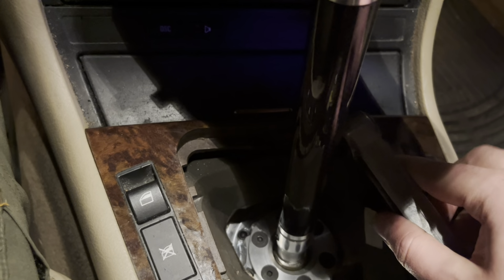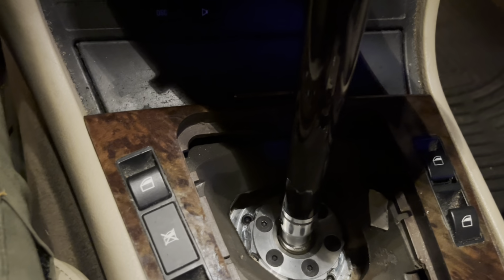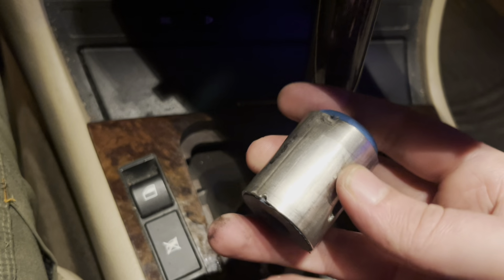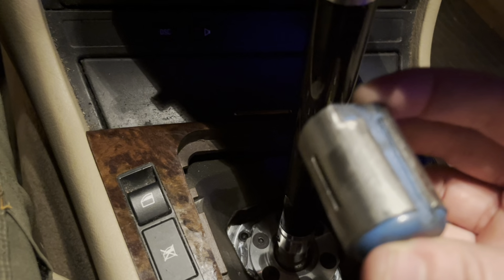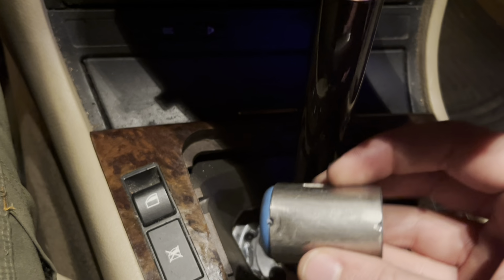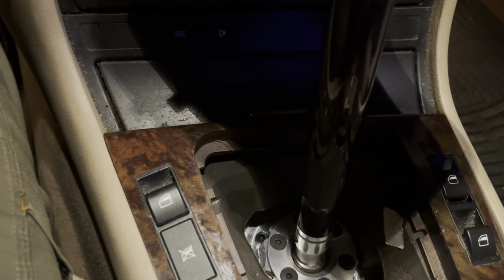You then have to turn your view to the back of this, which is going to be this portion where the carrier bushing is installed, this thing right here. And so what you're going to actually do when you look to the back, this is going to be sitting kind of wedged up into these two brackets. You're going to take a flathead. You're going to just start to pry that out one piece at a time. This thing will come out, and then your shift linkage will be pretty much free to come out,